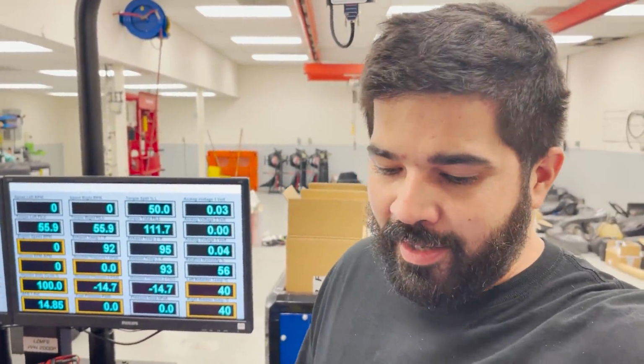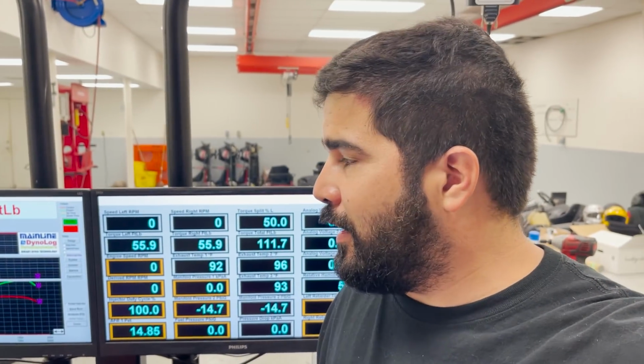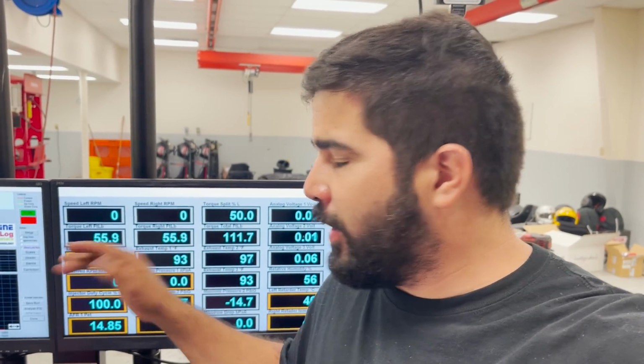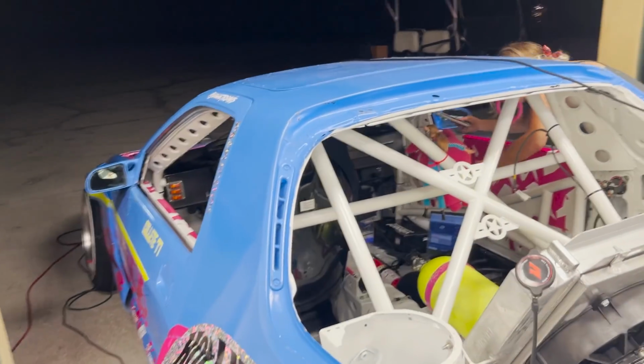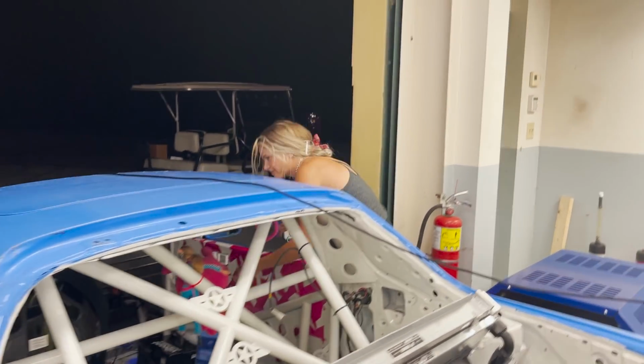If it doesn't, we'll just come back and give it higher boost. Right now 14 pounds is really nothing on a 20B, especially on the 85. That's like pump gas power. So we're gonna leave it at that, break it in, make sure everything's good, no big problems, and then we can go for the high power so you can do those big numbers.